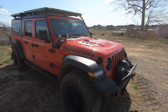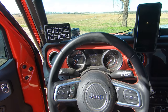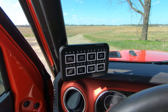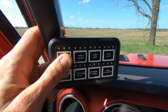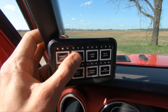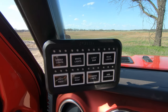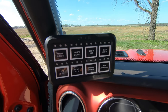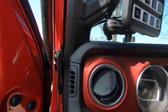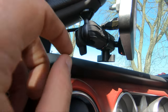Let's move on to the interior. Starting from the driver's seat, the first thing on the left-hand side is the S-Pod HD panel that controls eight circuits. This controls all of my lights, many of which have an alternate strobe or dimming function, as well as my onboard air system, which is an ARB Twin Compressor. This panel is mounted on a Carolina Metal Masters Grab Handle 20mm ball mount and a 6.7 Designs arm and HD panel mount.